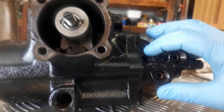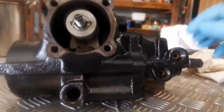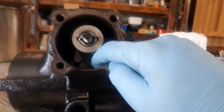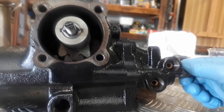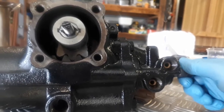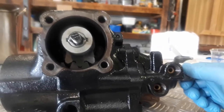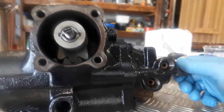This is where the hydraulics for your piston is. Your piston's up and down in here, of course. So you've got play between that and the piston teeth. Just a few millimetres actually gave me about half a steering wheel of play. So it's quite a lot when you're up at the other end at the steering.